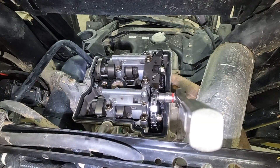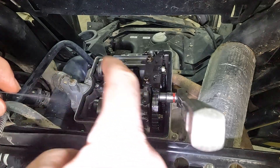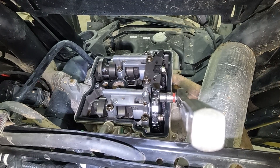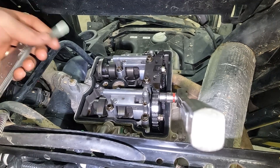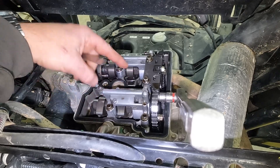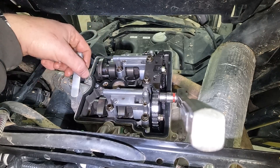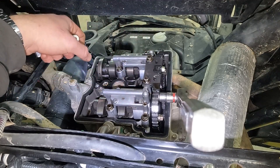We've got 0.001 on the intake valves — that is tiny. So this is why it's not starting. The valves aren't closing all the way. So we've got to get some different tappets in here, some different size tappets. There's a calculator available online, but in order to get the right readings you have to take out the current tappets to know what size they are. Then I'll tell you which size you need to get in order to get the correct gap. So in order to do that, you've got to take all this stuff apart — we'll be doing that now.